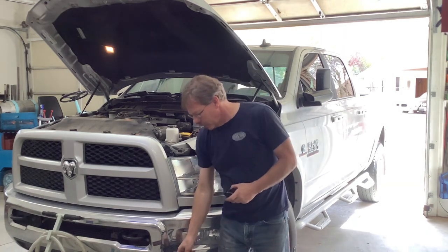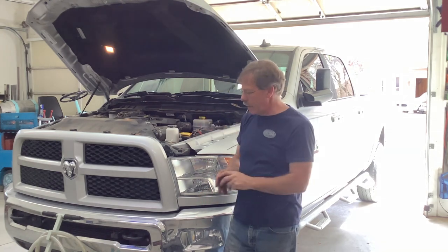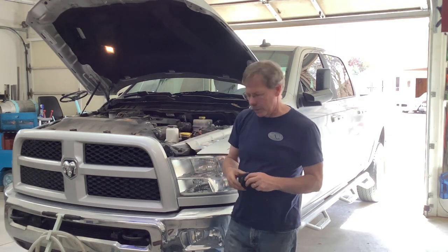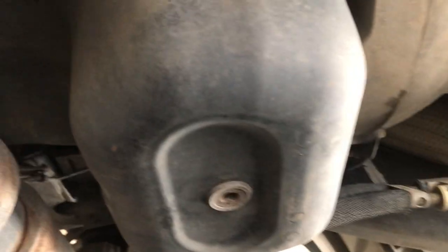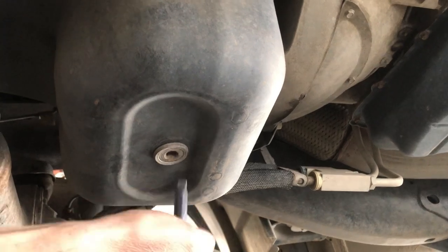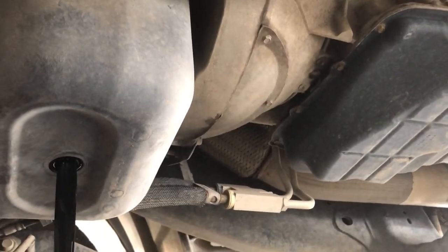So that filter plug and a filter wrench would get it done. I'm going to take you around to the other side — I'll get my smaller camera under there and show you where the drain plug is in relation to the oil pan. Under the truck from the driver's front side — mine's a four-wheel drive, that just means there's more stuff in the way. You can see at the very back of the oil pan, near the very back of the motor, there's the drain plug, and it's just got a square fitting in it. We're going to take that loose. That is some black oil.